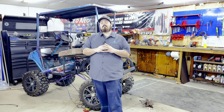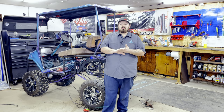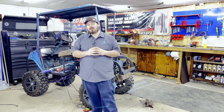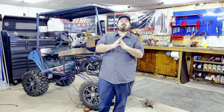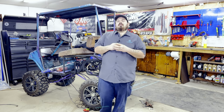So what I recommend basically for every make, model, and machine in the CFMOTO realm, whether it's a C-Force, U-Force, or Z-Force, you can't go wrong with B2 or even B3 if you really want to be aggressive. Now, if you're that type of person who occasionally mud rides, but you road ride, so you want to be able to still do 50-60, I recommend clocking to C1, because C1 will get you the low end torque that you need to do the minimal mud riding that you're doing, but it will also allow you your top speed.